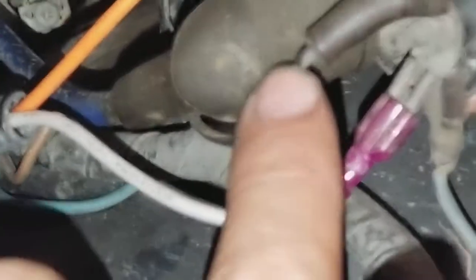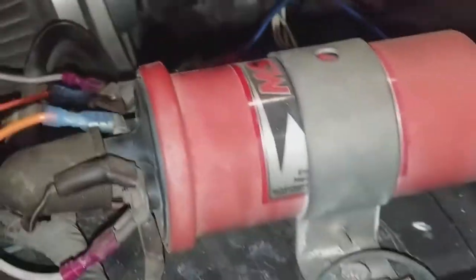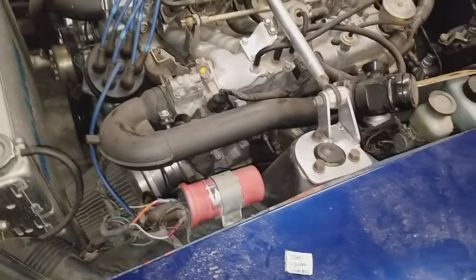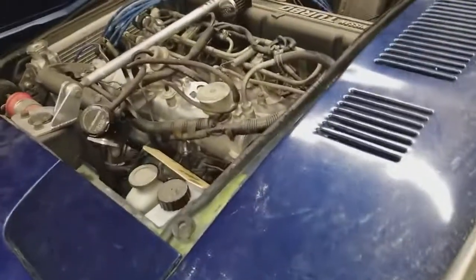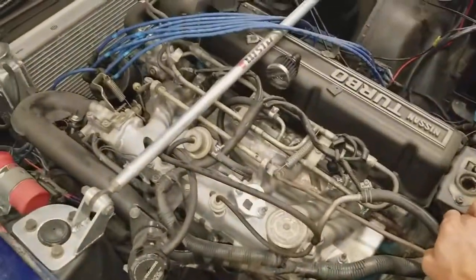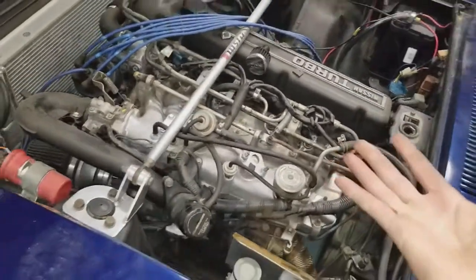This is a black and white wire that goes into the coil up here, and then the green wire and the black wire can connect to each other, or it has a resistor. That's how it's wired up — hopefully that helps you out. And here it is running — it works.